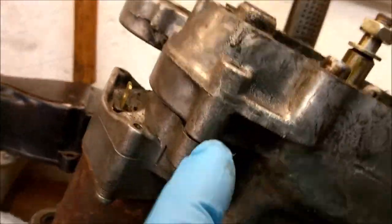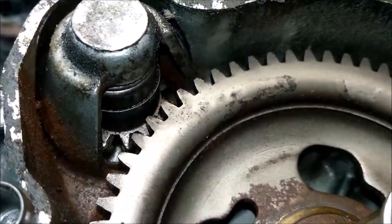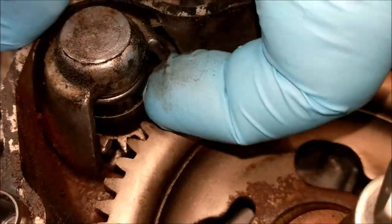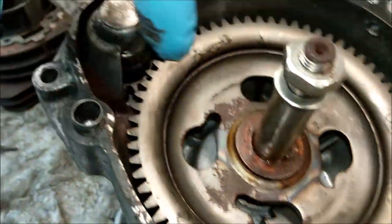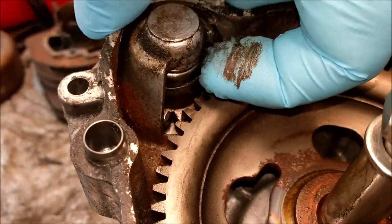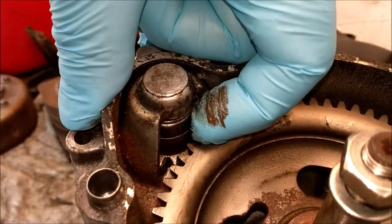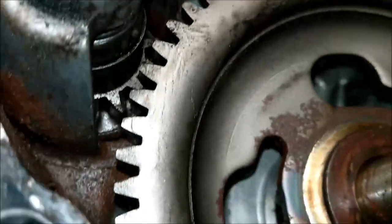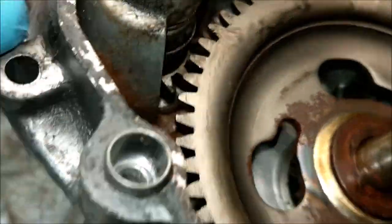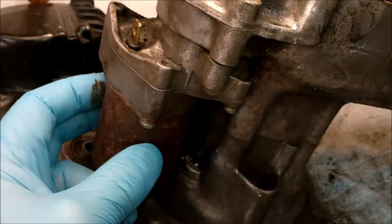So I thought to myself, well, there must be something in here holding that in. That is the gearing of the starter motor, the Bendix, which comes forward like so and engages this gear to turn the engine over when you press the starter motor, because it's on a spiral drive. So that's that. But I can't see anywhere in there where there's a bolt to undo, to drop that lot out of there. So I'm still none the wiser.